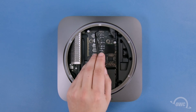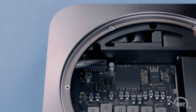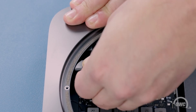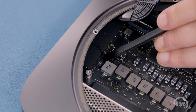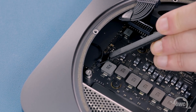There are two more cables to disconnect. First is the logic board power cable — this should come straight out of its socket. Next, disconnect the smaller cable near the front. It lifts out of its socket, much like the fan connector did.